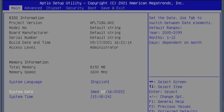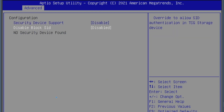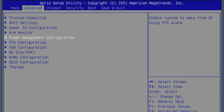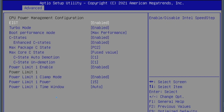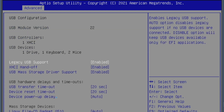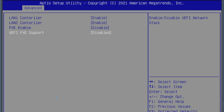I'm going to go through the BIOS just to show you what it can do — it has a lot of options. Here we have the BIOS screen showing 8 gigs of RAM at 1600 MHz. Under Advanced you have trusted computing, which is relevant for Windows 10 and 11, ACPI settings, Super IO chip, hardware monitor, power management, and CPU configuration where you can manage CPU power and boot performance mode. There's also VTD, USB configuration, and network boot options including no-disk PXE and UEFI PXE support.